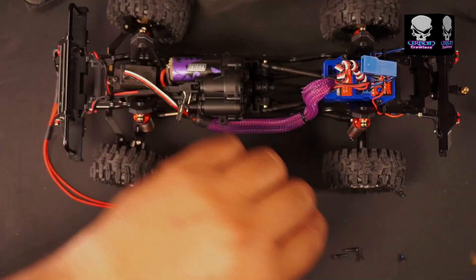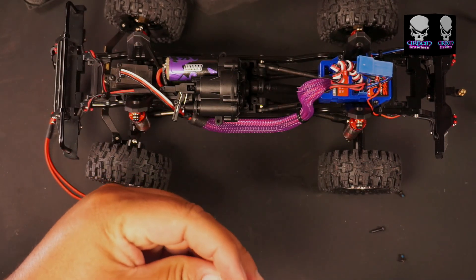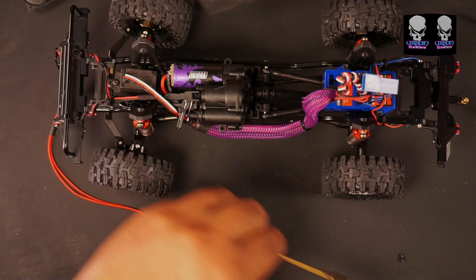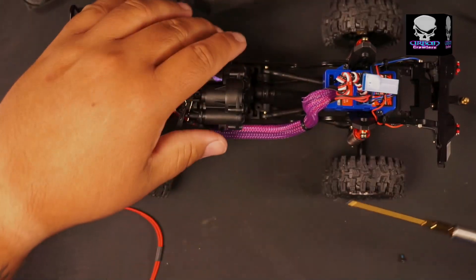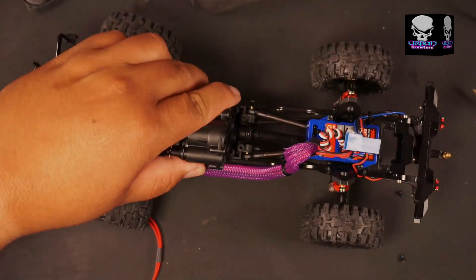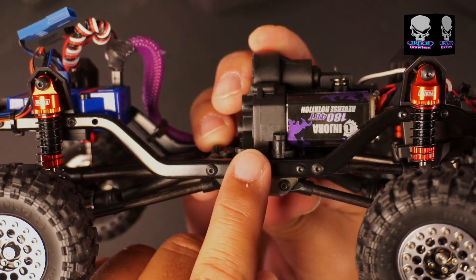Let's get the rest of these screws in. I noticed the screw was smaller but I didn't think anything of it — I was like, it's probably just my head. Nope, there's always a reason. Now we know the reason. I've got the extension on. The long screw fits perfectly now on this side and everything's fitting down. The transmission is sitting on the transmission mounts — this is the new mount. Rotating this over, it's sitting really good on the transmission mounts.